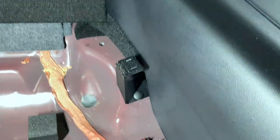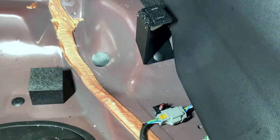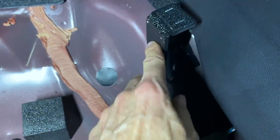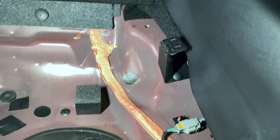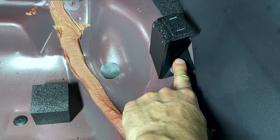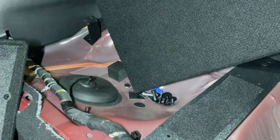The seat supports go down into the lower seat belt hole, which is normally threaded. I used heavy-duty push pins instead of tapping it since I already had the panels in — that supports the corner. There's velcro on there that matches the underside of the rear seat delete. There's another pin in a covered hole on each side. The rear seat delete is just sitting in place — not secured yet because I have to cut it for the kick legs. There are also a couple pieces of material that go in the corner — just tuck those back behind the plastic panels.